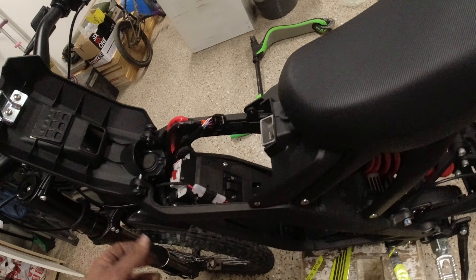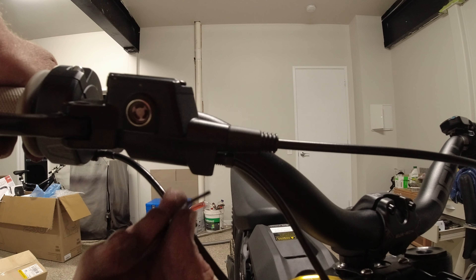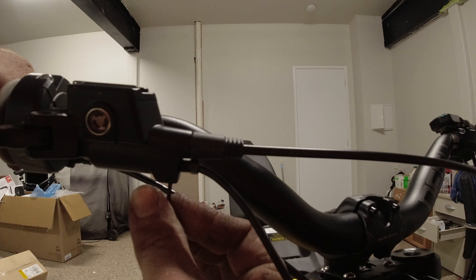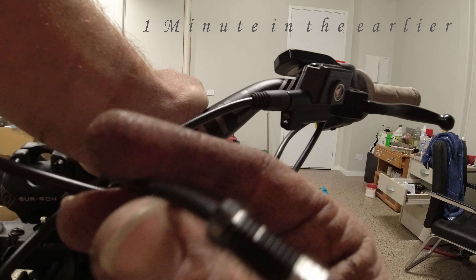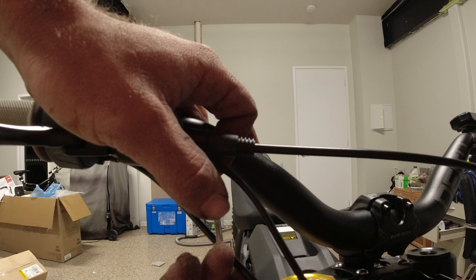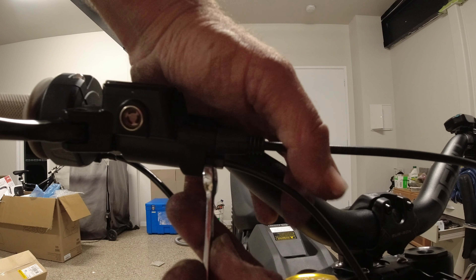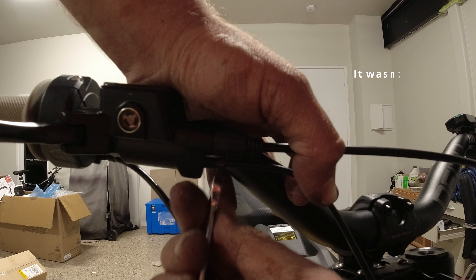Unhook that — pretty straightforward. The tip-over sensor is behind this stuff. So we're loosening that off to make life a hundred times easier. The brake is pretty messed up, but I'm gonna get some Magura MT5s anyway, and that'll be a lot easier to undo. So with the seven mil — this one probably goes towards the back of the bike. Back that screw off — it's possibly stripped as well, but you get that.